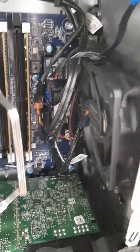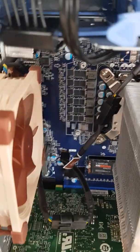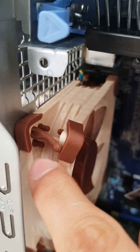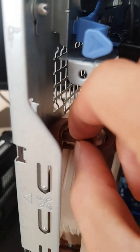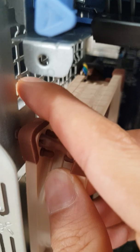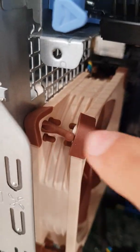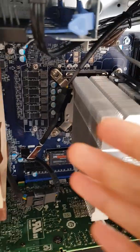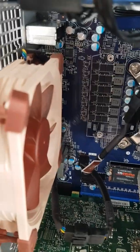Once the HDD is removed you have space at the front for the stock rear fan. To take out the rear fan, you release these rubber mounts — they just release and go loose. Then slowly pull the fan with a bit of pressure; it's held on at the back so it will come through the hole and then release. Do all four corners, being careful in the tighter rear space.